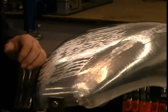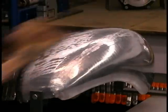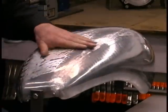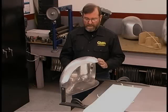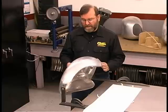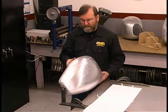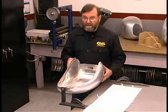Then we draw the file over it again. This time the low spots are about half the size they were previously. We've completely metal finished the tank now, and it's very smooth — all the contours are very continuous. We're ready now to make a pattern for the bottom of the tank.